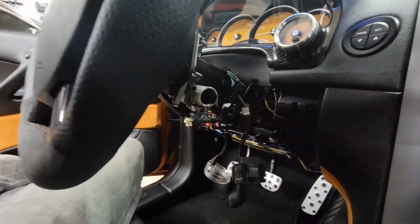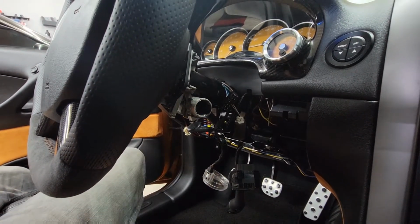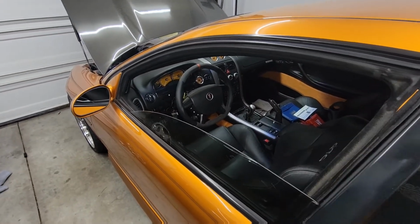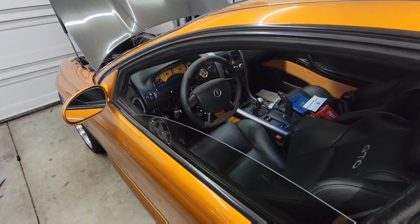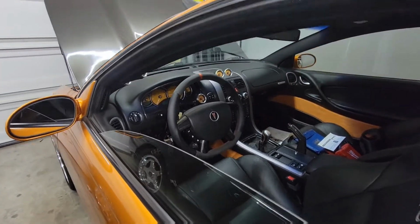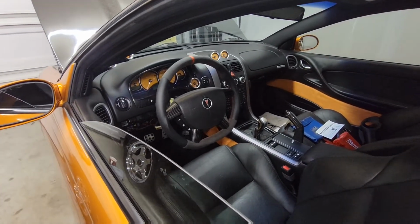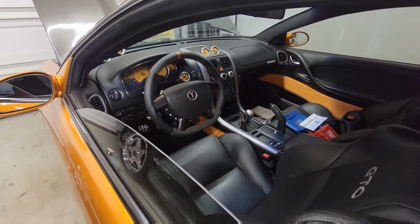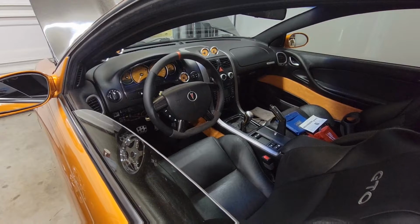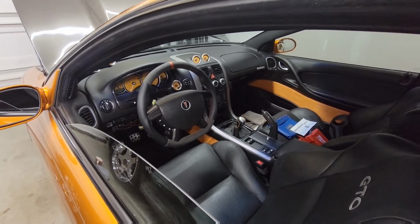Putting in a steering column in these isn't terribly difficult. It just wasn't something that I wanted to do at this point in time. But it still sucks that that happened, since I've literally driven the car once since the steering wheel spokes got put in. I don't know, it must have been the shock of me having to physically break loose the bolt that holds the steering wheel onto the column that caused the tumblers to just not do their thing and cause the key to seize, or the ignition to seize, along with the worn ramp on the lock cylinder. But hopefully this fixes the issue.